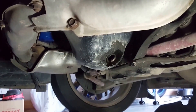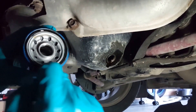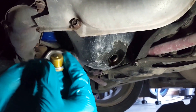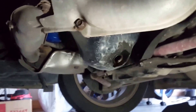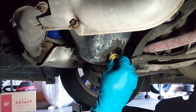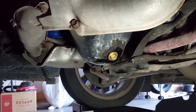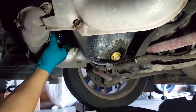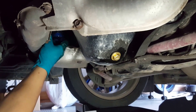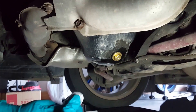Let the filter drain down a little bit as well. While we wait for it to drain, we can get the new oil filter ready. All you want to do is put a little film of oil around the o-ring. You also always want to change your drain plug gasket. Now that we've got the old oil filter out, we can tighten down the drain plug.